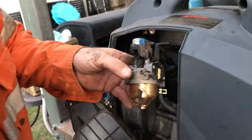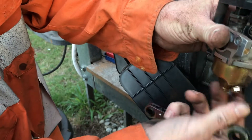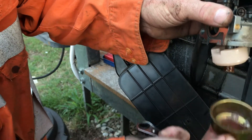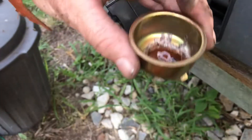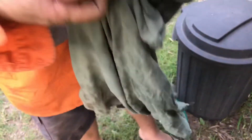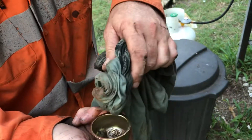It's still a bit tropical. I'm just going to drop the bowl. You can see it's had corrosion in there, so there has been water sitting in there. I'll just give that a bit of a wipe down with my finger just to get all that crud out. It's not 100% clean but it's good enough. As long as there's no loose stuff that's going to work itself back up into the main jet.